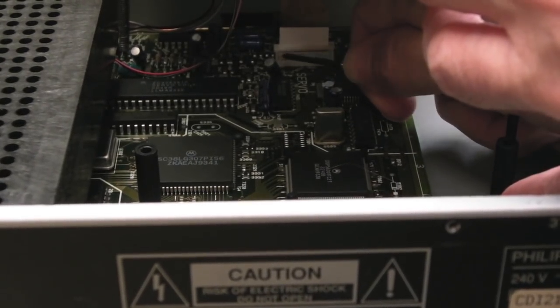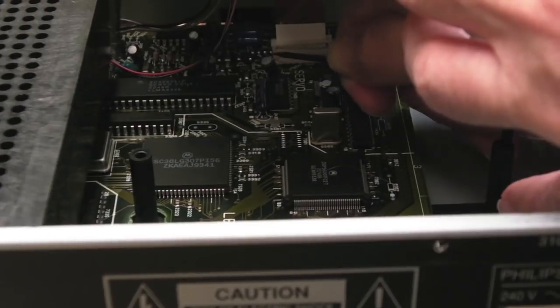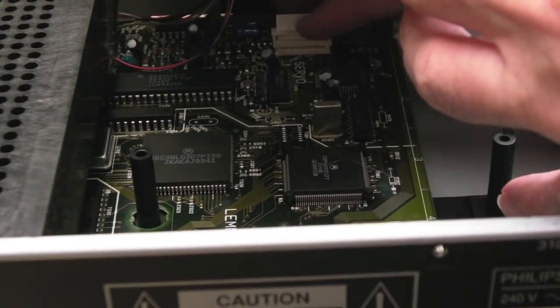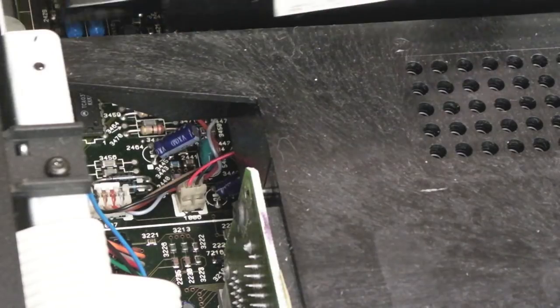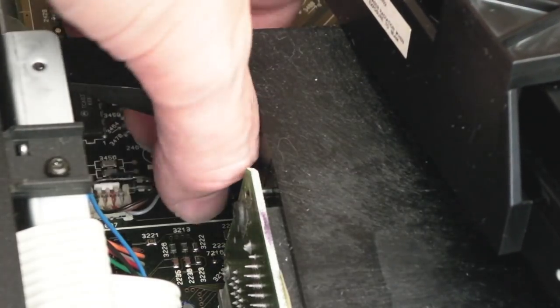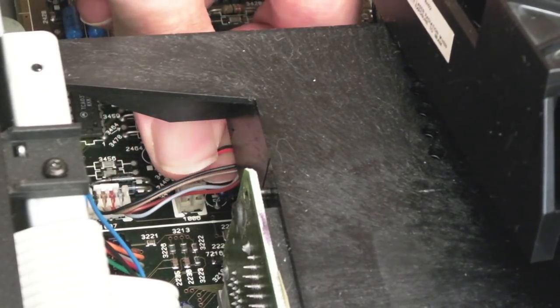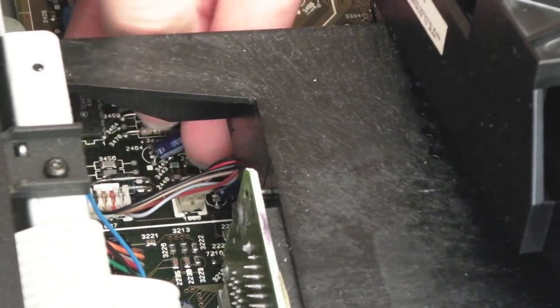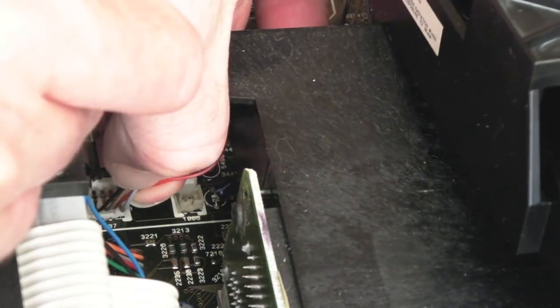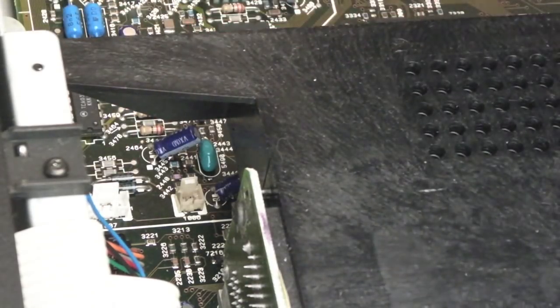Lift the housing on the flat flex there — both sides. That's it. The ribbon should slide out, and then the drive will lift on the top of there like that. With that first connector there, it should just pull straight upwards. I shouldn't really pull it by the wires, but it's only lightly held in there — it's easy to get that out. Then this one — just use a little screwdriver to move the little clip to the side and pull the connector up. You can see the little clip there. So that's the drive now free.